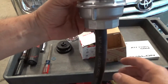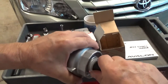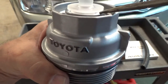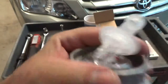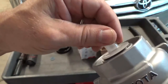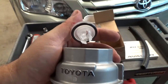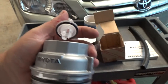When you're underneath the car — everything's close, everything's hot — to get the hose off, you could try and pull it out but it's going to be difficult. There's a gap in there that allows you to get your screwdriver in and pop it off. With the O-ring in place it's extremely difficult to pull out, and if you try to get your screwdriver in with the O-ring in there you're going to be deforming the O-ring. That's what Toyota's instructions tell you to do, but I do it another way.